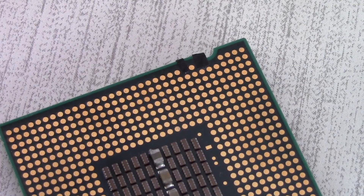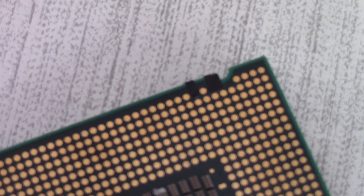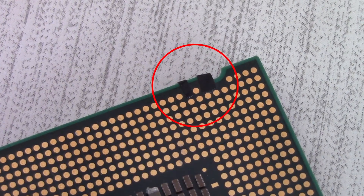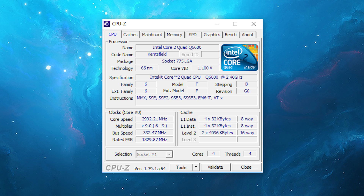As you can see I've covered these two contacts with tape, and after that I just put the Q6600 back in the PC with the stock cooler. You won't notice a difference in control panel or device manager, but opening up CPU-Z will tell you all you need to know, and as you can see this thing is operating at 3GHz in an otherwise non-overclockable Dell system. I'm not 100% sure on which CPUs or motherboards this works with, but I believe that some Core 2 Duo series chips can benefit from this too.